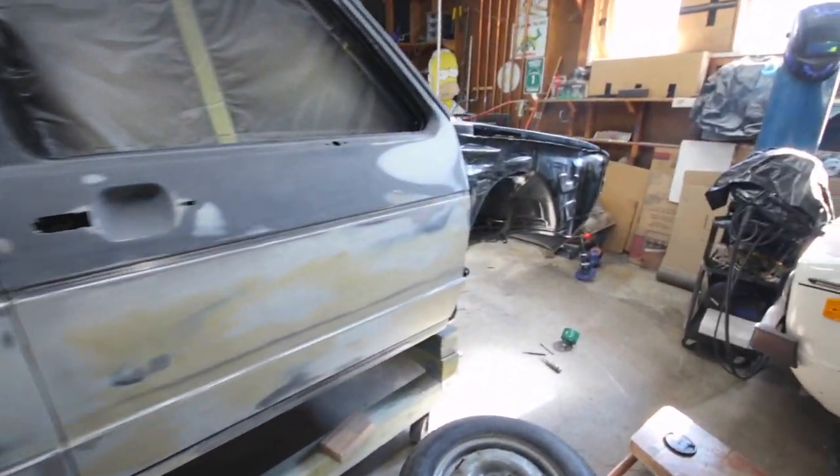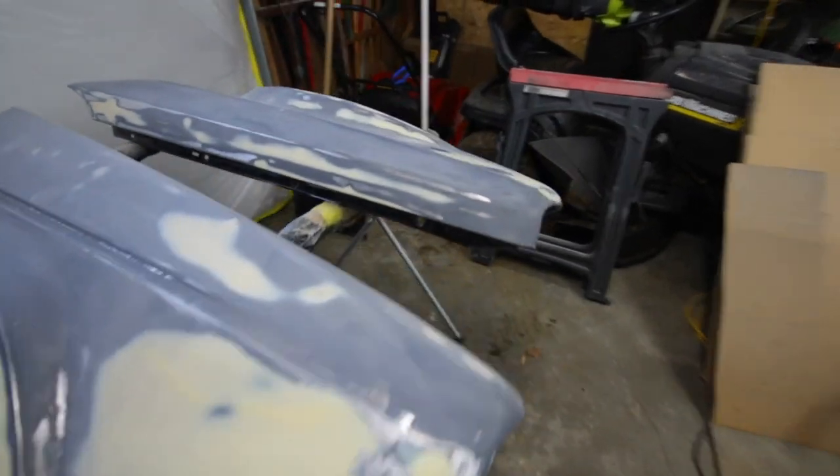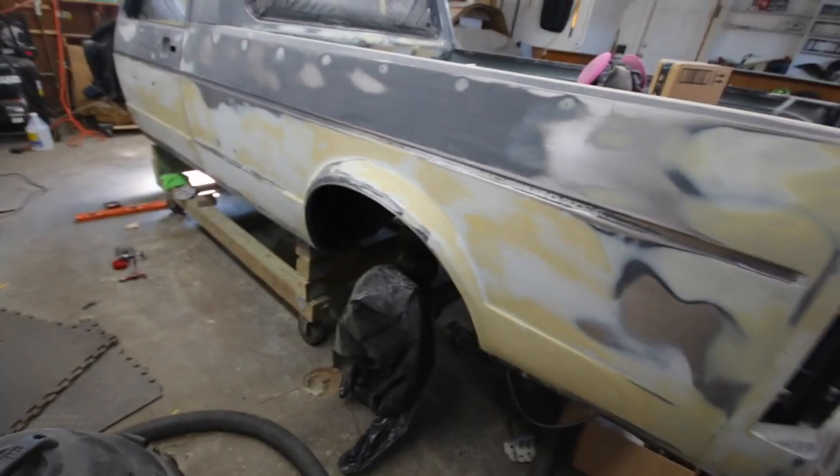Pretty much most of the bodywork is done — as you can see the fenders are over here, everything's all pretty much good to go. That driver side is still done. Right now I'm basically waiting for warmer weather to pro epoxy this. I'm gonna epoxy it, let it dry for almost a week, and then go back over it with high build. The epoxy — what I'm supposed to do is leave it at 65 degrees for 24 hours before I spray it. The metal has to be that temp, and then it has to sit for 24 hours at 65 degrees at least. It's the standard for the SPI epoxy — it's really good stuff and I trust it, so I'm kind of gonna do it by the book so it's done right.